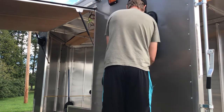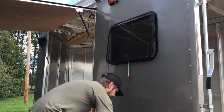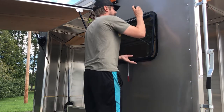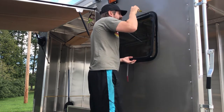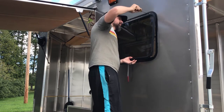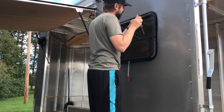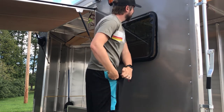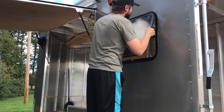What I realized was that once you lift the window to around 30 to 45 degrees, since it is a two-piece hinge, you should be able to just slide the window to the left or to the right. But first you have to remove one of two screws — they're on either side of the hinge, acting as stoppers so the window can't accidentally slide when open. I removed the right screw.